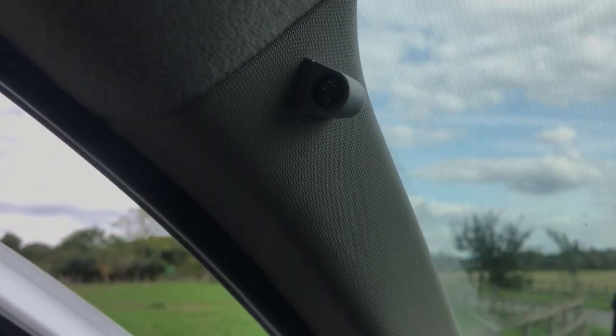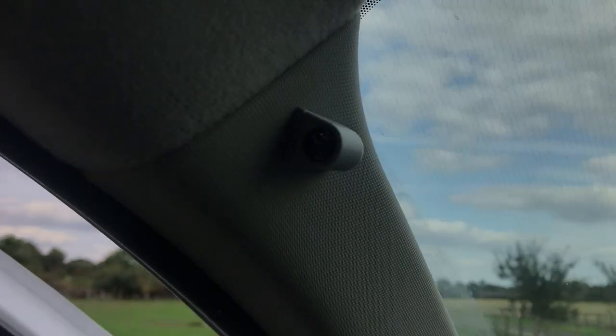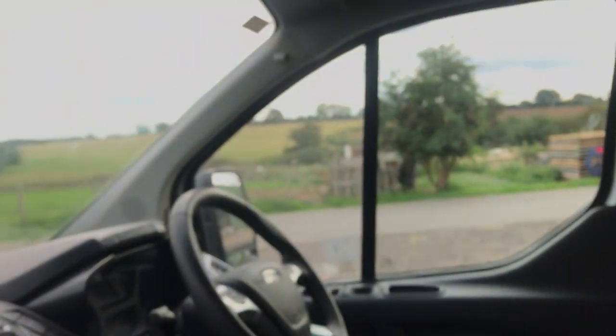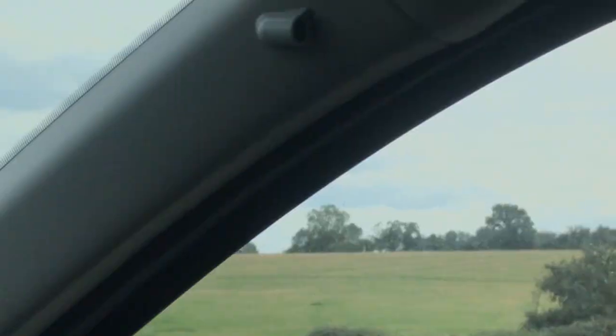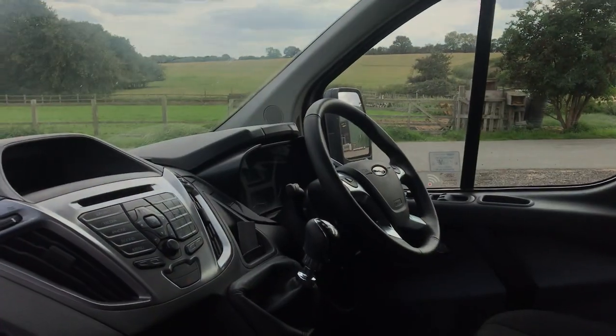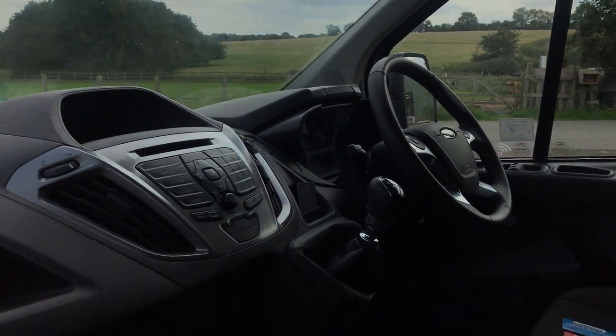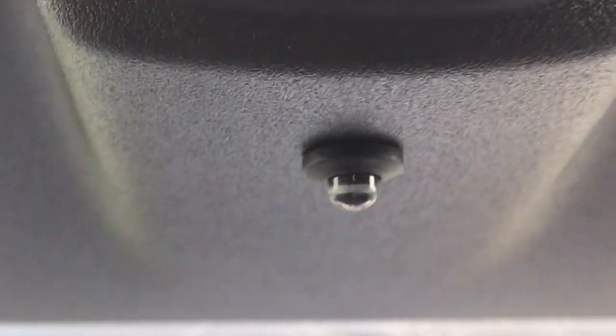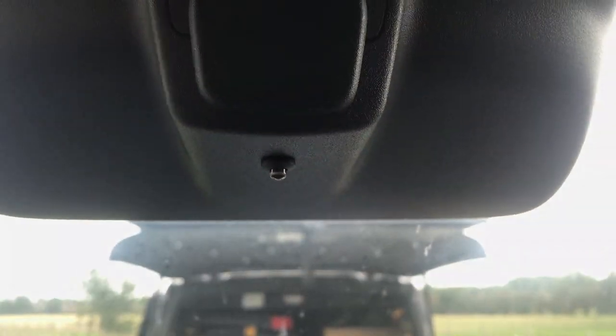The one on the opposite side receives — that's a microphone that receives the sound pattern. When you set the alarm, the ultrasonics take 30 seconds to settle down. We've also fitted an internal high brightness LED, because the LED on the Cobra system isn't that bright. I prefer putting extra LEDs on there simply because it's nice at night — when you're near the van, the cab lights up quite bright.